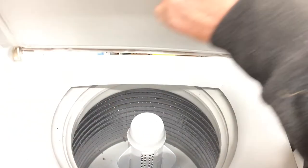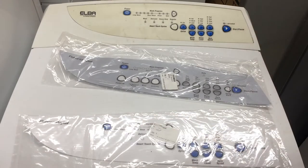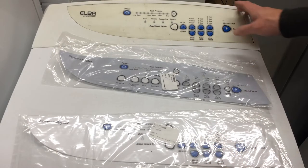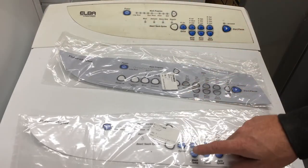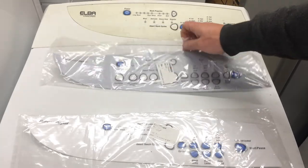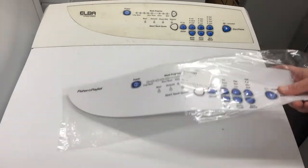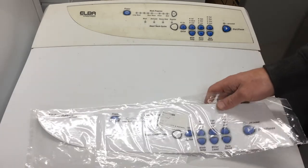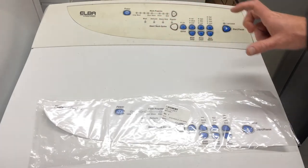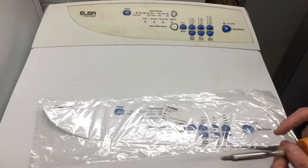There are two different decal part numbers. Fisher & Paykel used to have several different decals in different sizes, but with this shape the control panel will be longer or shorter at one end, meaning they only need two decals. Part number 421172 is the current part number for the WW model, and 421171 has the fancier more options. All the Smart Drive 11s, 12s, and some 13-series use the same two decal types. You can't just swap a fancier sticker out and get more options — it's to do with the PCB, display board, buttons, lights, and water valves, which differ between models.